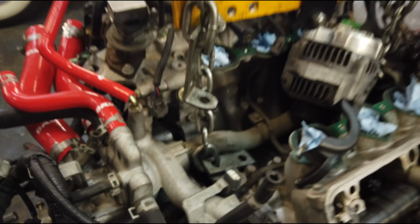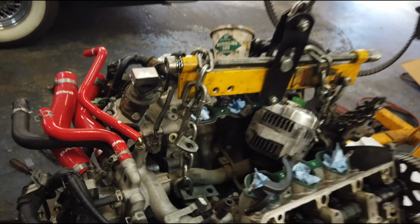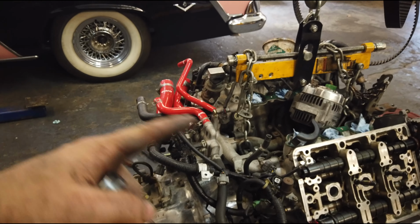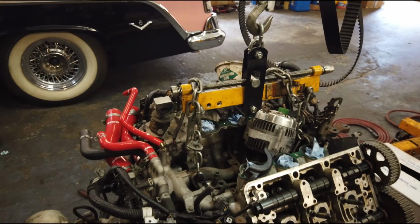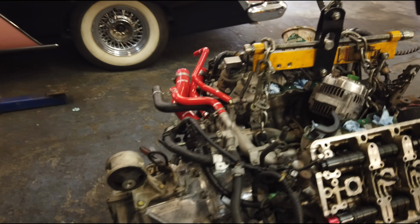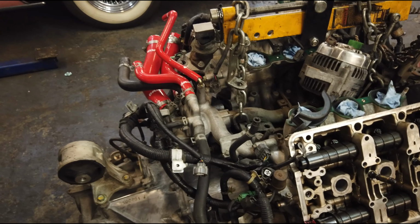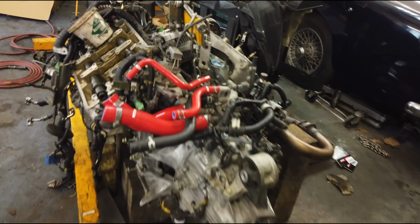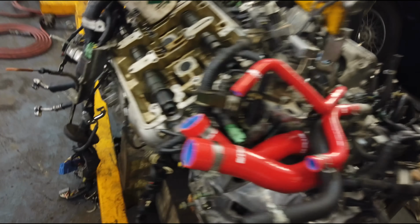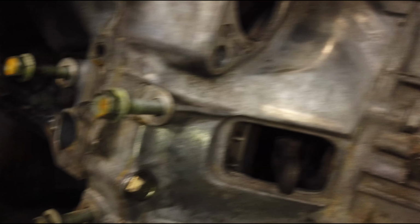So I'm going around and doing subframe bolts just around the transmission housing slowly, and it's sucking in, so it is working. If you do this, you don't want to do it too hard, just because everything's aluminum. You could strip things or crack the housing, so don't be too forceful. So once you're done cinching everything up, you torque the transmission housing bolts to 33 foot-pounds. It's not the most important thing, just make them snug.